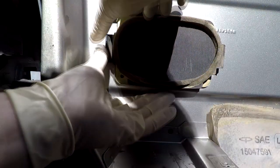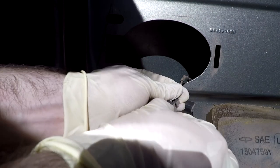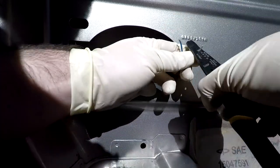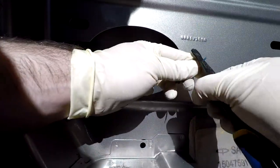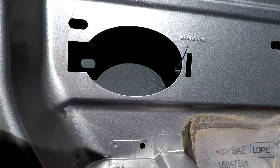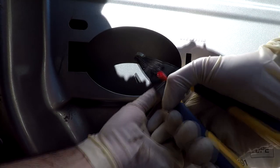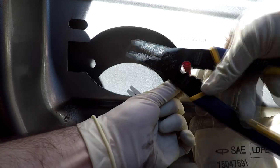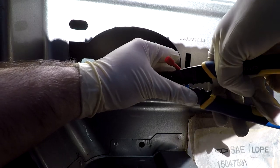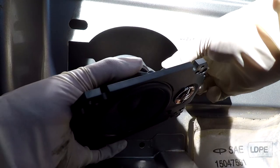The speaker removal is the same as the front — you just push on the tab and the speaker slides right out. Then push on the tab to remove the wire harness, or you can snip off the wire harness. Strip off the insulation — I'll have the speaker wire information in the description. For these speaker wires I'm going to use an insulated tip so it's not making any contact with metal. Per usual, blue is negative and red is positive. Crimp the terminal ends on, making sure they're nice and snug, then attach the negative on the light blue wire.